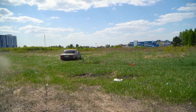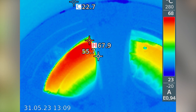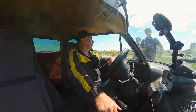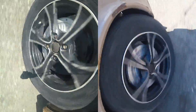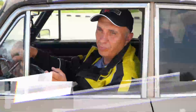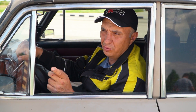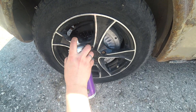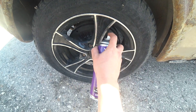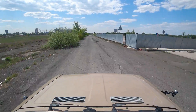What's the traction situation? Temperature reading, Sergey? 67, 68. Really? Why so underwhelming — 68 degrees, that's it? Did you notice that the wheels were locking up in turns? I don't get why it did that. Now even though they are aluminum, they do radiate quite a bit of heat. So where we applied some black paint, we're getting a much more accurate temperature reading. We're going to spray some paint onto the drums in order to get the exact temperature — no pads are gonna be removing the paint, so we should get a good understanding as to how hot they're going to be getting.